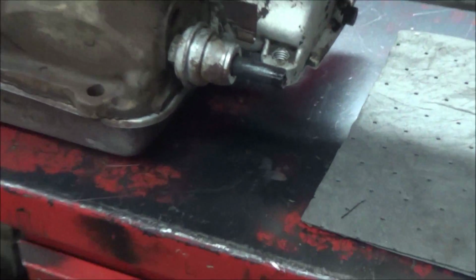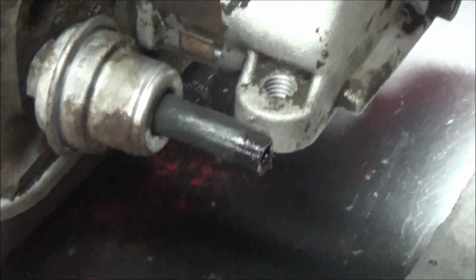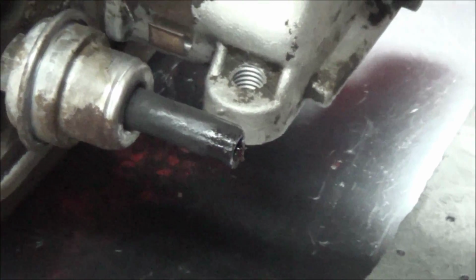Well, I think I know where the oil leak is. That's the vacuum modulator over here, and there's fluid coming out of there. I'd say the diaphragm is probably broken. And that's probably where his oil leak problem and the shifting problem is coming from. So, anyhow, I'm going to rip this thing apart probably tomorrow, and we'll put you back on then.